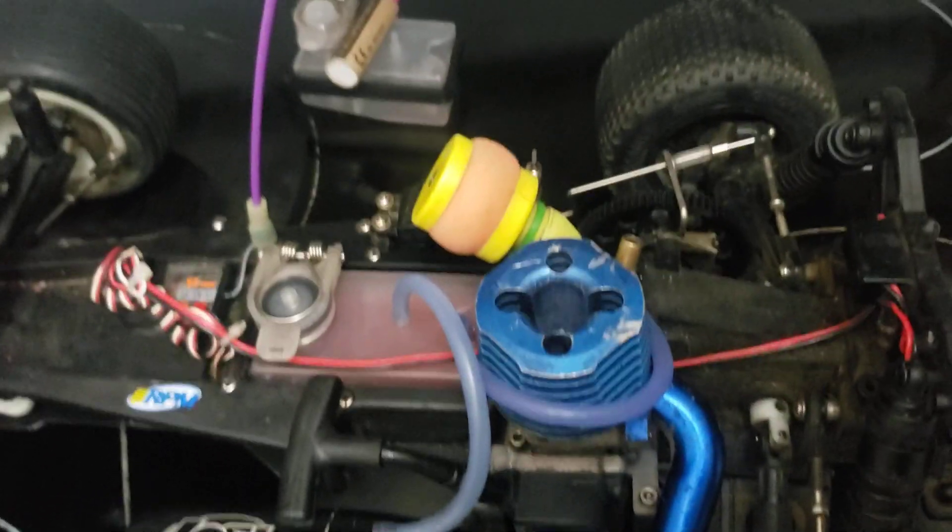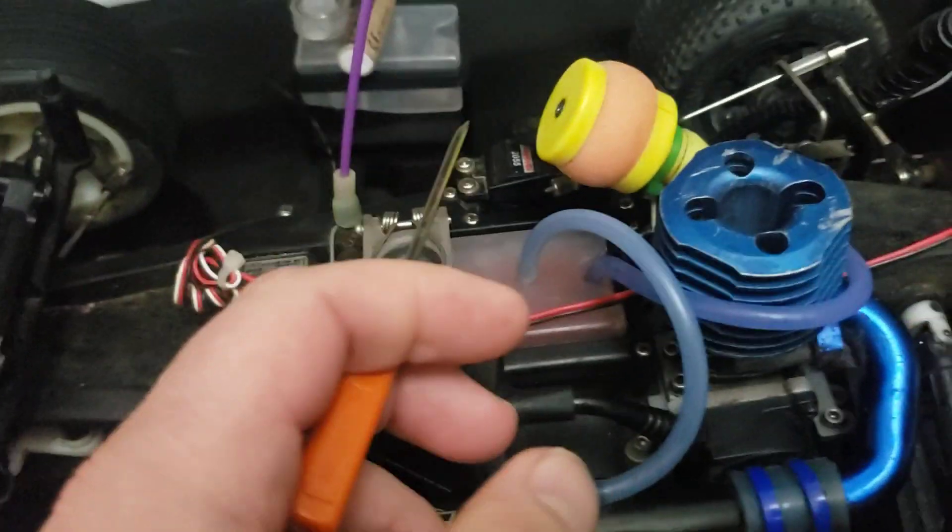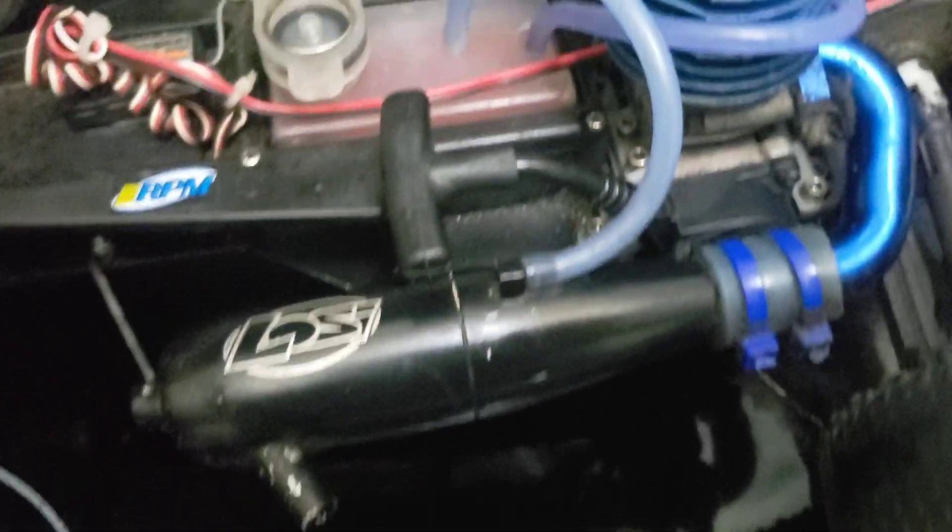This is in response to my last video about the fuel system on this truck. Swapping out that tank made a huge difference because that old one — which is going to get blown to smithereens tomorrow on video — had its pressure tap all the way at the bottom of the tank and was filling the exhaust with fuel, causing all sorts of problems.